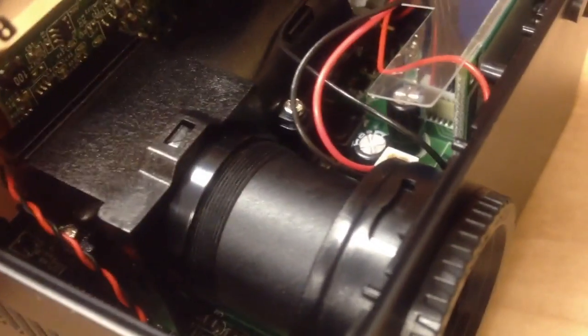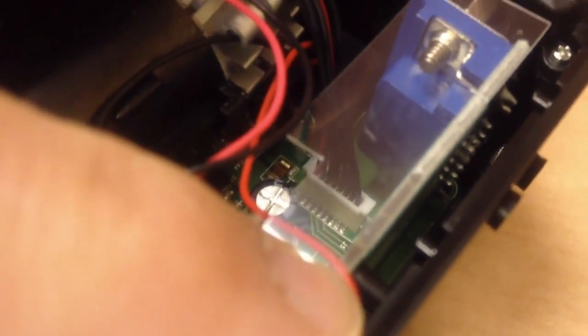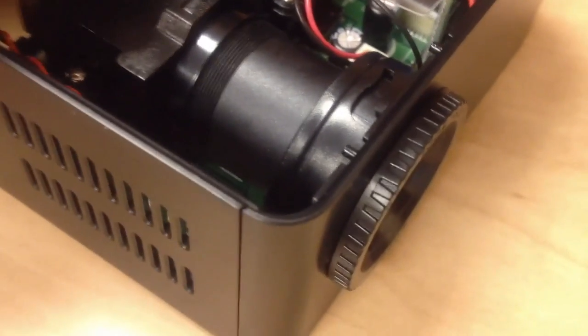On the back of the projector there are four screws — I'll remove those. After removing the four screws the back comes off. You have to pop the lens part off to remove the front part of the case; it just pops off, held by a spring piece. The two boards — the RGB connector and the RCA connector boards — just come right out. The front also has a Phillips screw that will need to be removed.